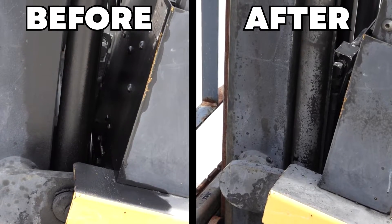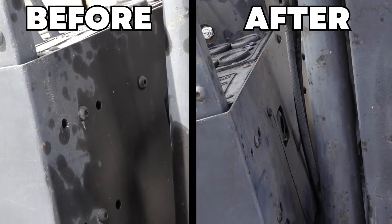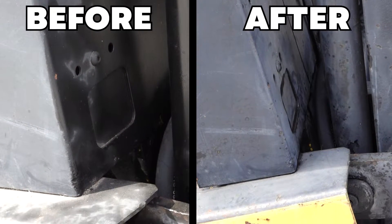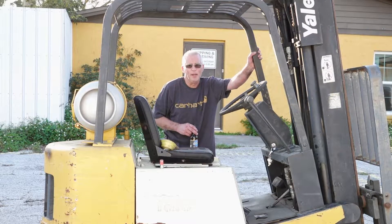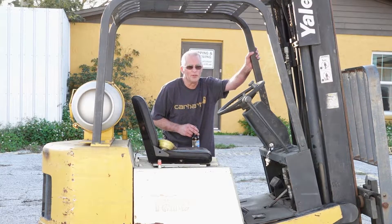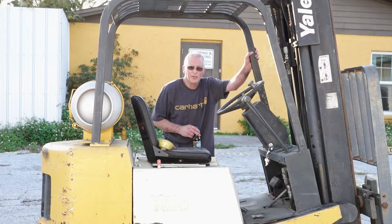This makes it water soluble so you can wash it off with a hose, which is nice. If you don't do that, you're going to have oil dripping on your driveway. If you're using the forklift in a warehouse, the last thing you want is hoses breaking and spraying all over your building, equipment, products, whatever it is you're moving around. So when your kids are playing around on the forklift and they blow a hydraulic hose, it's probably not their fault — don't get mad at them. It's probably your fault for not maintaining it and replacing the hoses every few years. Easy enough to fix — take it down to your local hydraulic hose store and they'll set you up with a new hose. Put it on, you don't have to bleed it, you don't have to do anything. You're back up and running.